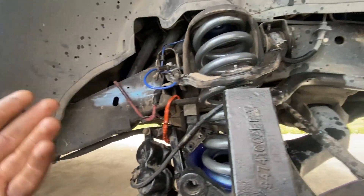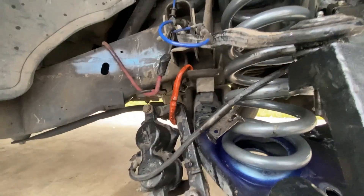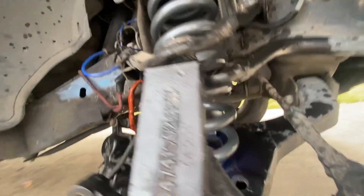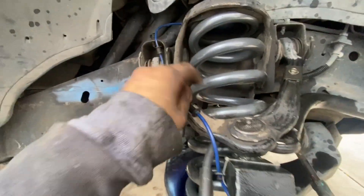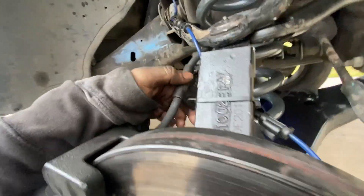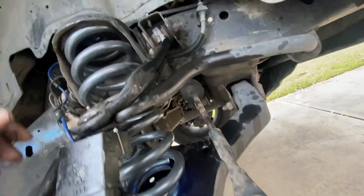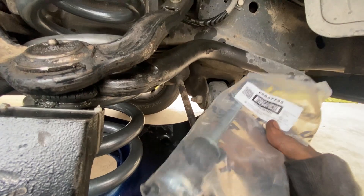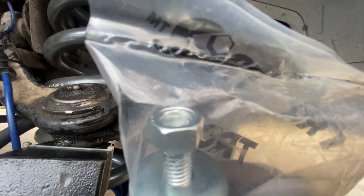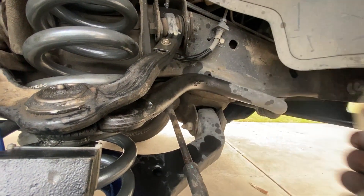You may even be able to get this done by raising the truck up less than I did. I'm going to go ahead and put back the brake system and put on this nut and back in reverse order. I put the suspension back on — everything's pretty loose and has room to move around. Chevy really designed this by running this cable right up against the spring. The sway bar end link that came off was very worn and bad, so that is getting replaced with a new one. They don't cost a lot to replace and the replacements have nuts on each end instead of having a nut and a washer nut, which helps a lot. So this is going to go back on before the shock.